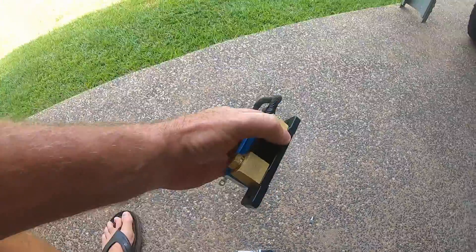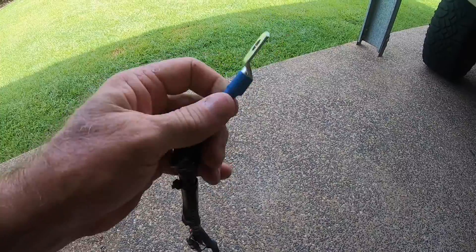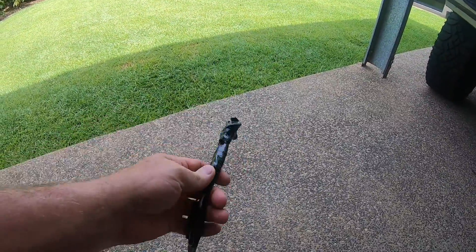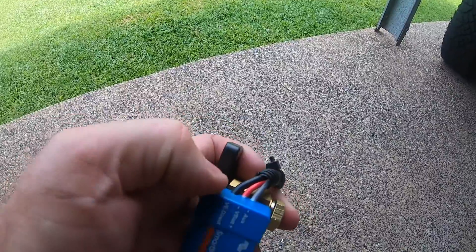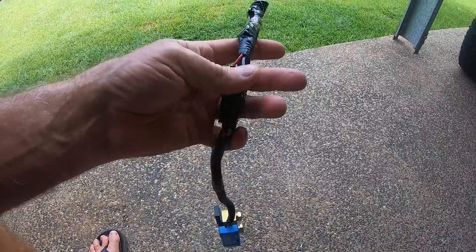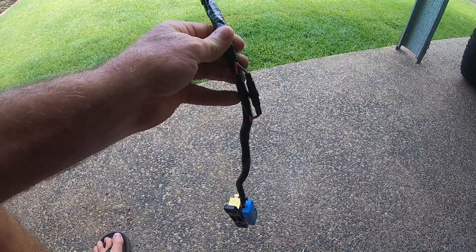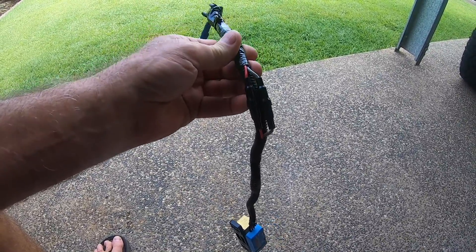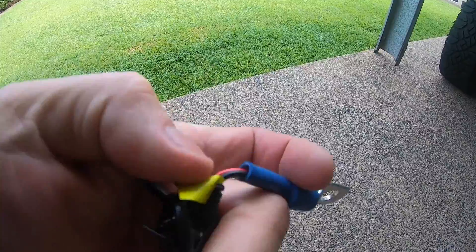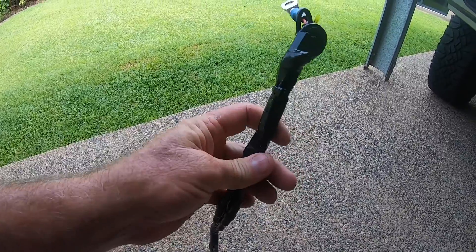Now the loom doesn't come this way. I've also bought a temperature sensor as well — it's got a thermistor in it and it measures the heat. You have to split off — see this little red and gray wire in here — you have to solder the temperature sensor to those two things. I've trimmed it up a little bit. The existing red wire had a fuse in it. The gray one didn't have a fuse, but the other one which has got a black wire did have a fuse — both one amp — so I've kept that in the circuit as well.